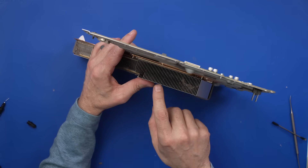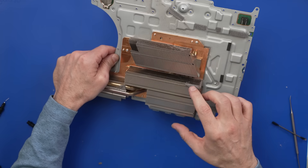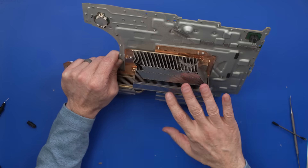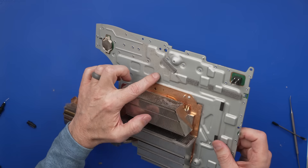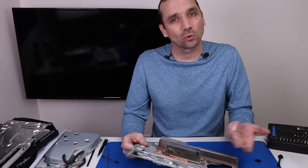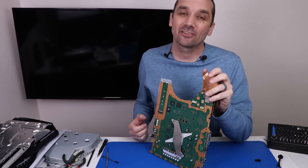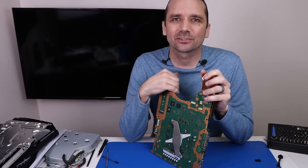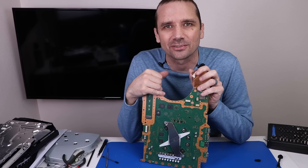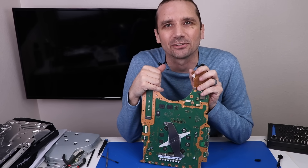Usually just a small amount of debris won't cause a huge issue, but it really doesn't take too much on these PS5s to cause a problem. There's also a little debris between the two heatsinks — these all need to be cleaned out. There's a lot of standing dust on this PS5, and this is all stuff that can cause the PS5 to overheat and or just turn off. That is how to re-spread the liquid metal on your PlayStation 5. If your PS5 needs a cleaning, I'm going to put my PS5 cleaning video up on your screen now. Don't forget to check out BW-100 — links are right in the description. Thank you so much for watching!